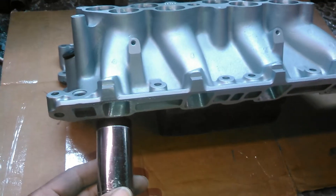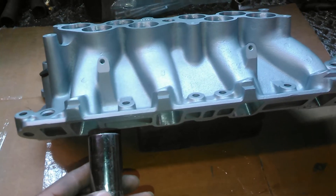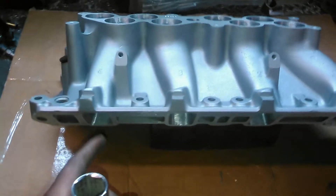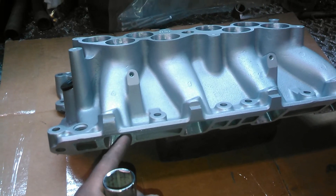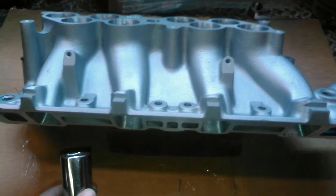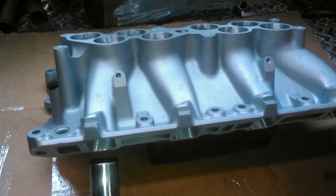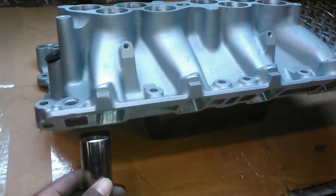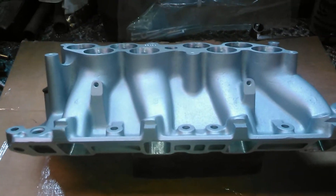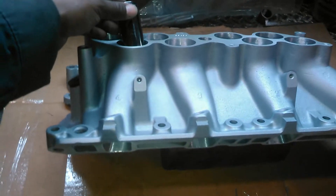It's just a quick little demonstration of what kind of port work we actually do. This lower flows over 400 CFM right now. That's a tremendous amount of CFM. Some of you guys say that's kind of high — yes, it is high, and yes, it does flow. So we're going to demonstrate some of these runners and show what this can do.